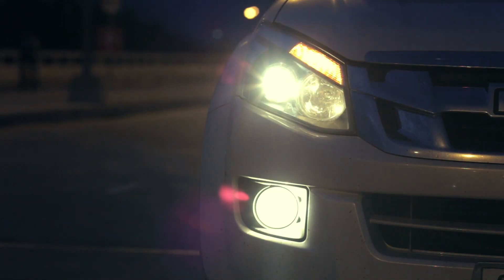Lights. The first thing you want to do is check the parking lights, turn signals, and brake lights. Then it's time to inspect your vehicle's trailer connection to make sure you have the proper plug configuration. Once you've hooked the trailer to your vehicle, it's important to check the brake lights again.